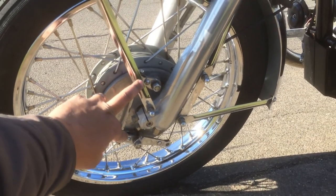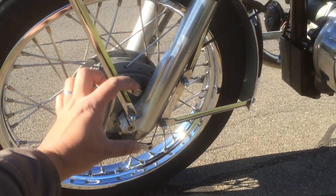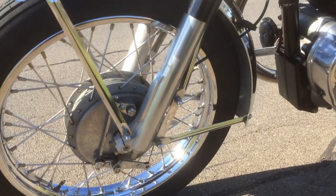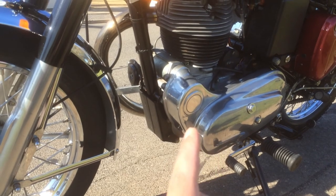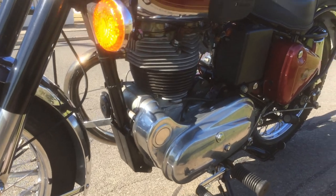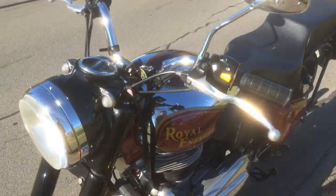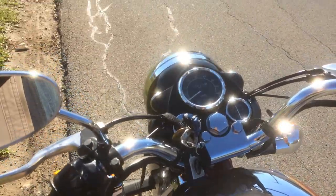Both the front and rear brakes are drum. The front brake is twin leading shoes, which stopped the bike better than single leading shoes, but nothing like a modern disc brake. The bike required three different types of oil: the main engine oil, the clutch primary oil for the clutch box on the left, and the gearbox needed a mixture of grease and oil. There's also a storage box and a battery box.